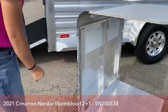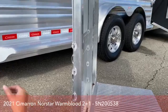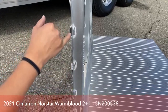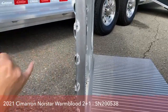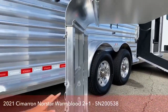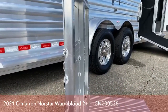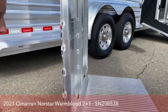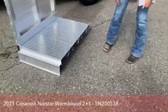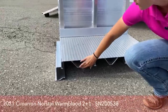On our Cimarrons, you've got the side extrusions. On a lot of trailers you'll see just a corrugated side — you get the look, but this actually adds a lot of strength. You can see how these are pushed out and air is able to move throughout these channels — that's exactly how it's set up. By doing these extrusions, you are adding an incredible amount of strength to your trailer while also saving on weight. And right down here we've got our floor system — our Cimarrons are a tongue and groove floor system with four-inch centers and a center V-truss. These are incredibly strong floors.